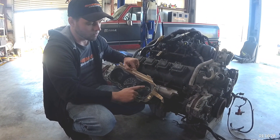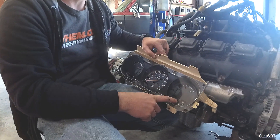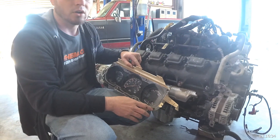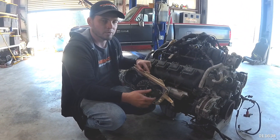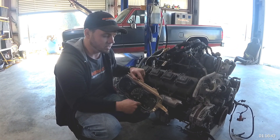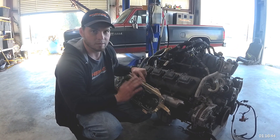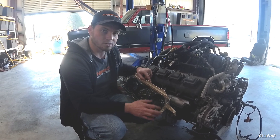The last gauge to cover is the fuel gauge, and that one is no different in your car. If you're using your original fuel tank or a reproduction EFI-compatible fuel tank, the factory sending unit is all original — keep it exactly as it is. And now all of your gauges are going to work.